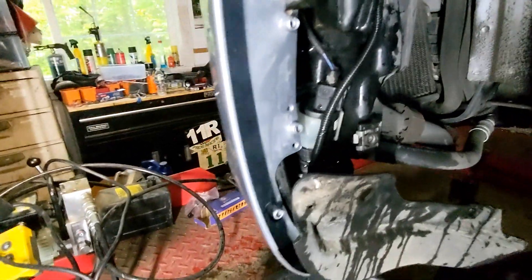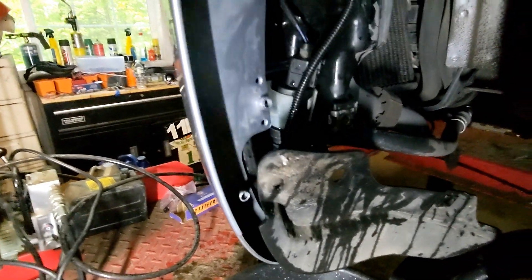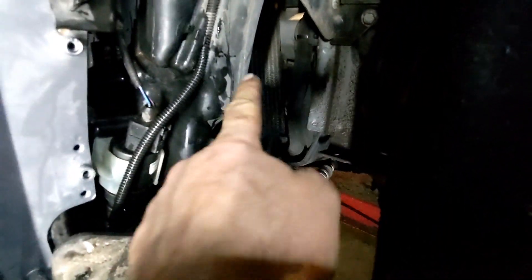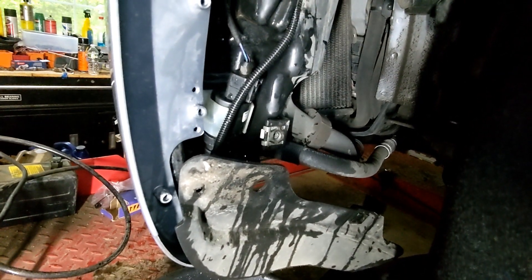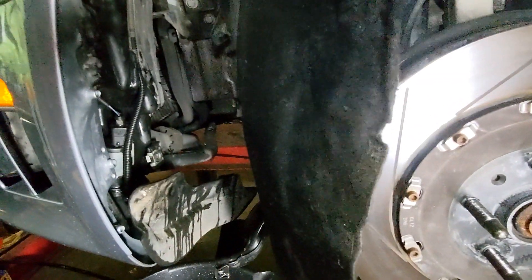It's a pretty quick thing to change the pump on this model. This one was dead — apparently it's a recurring issue. If it's the front pump you might have to take the entire tank to rotate it, or drop the whole front to access it behind the cooler, so it's much easier to do it from the back. It's a 10-minute job altogether.